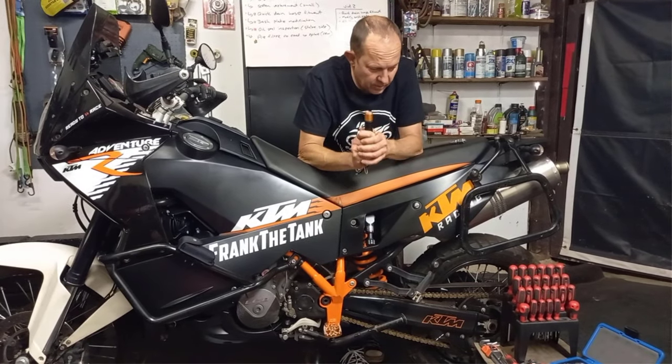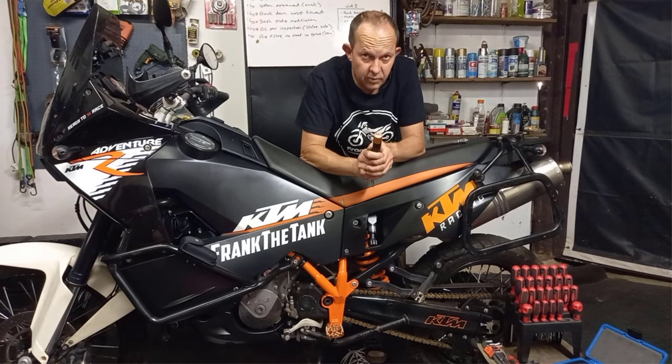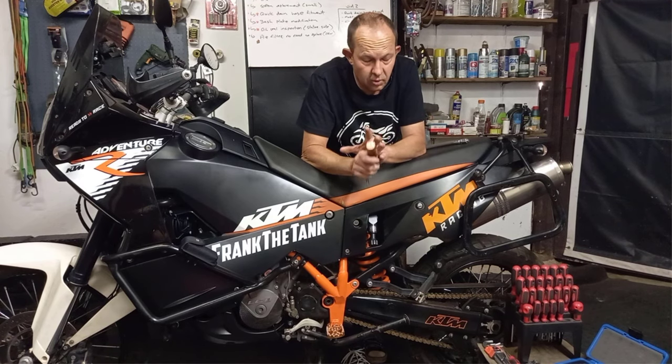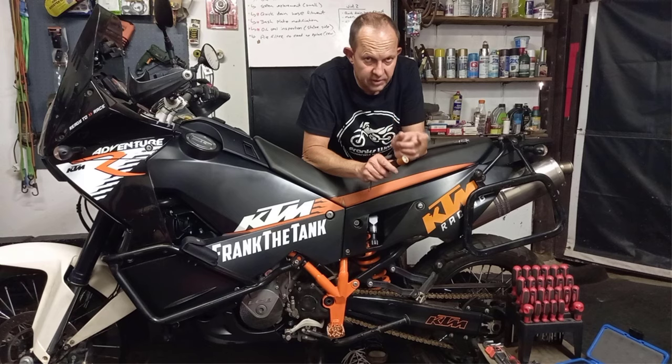On the plug side, I want to touch on the plugs. This is very important and you should take note of it. Your 990s, you have to have a look at the year model. I can't be 100% certain, but the earlier 990s had a shorter reach plug, and your later 990s, I think from 08 upwards, 09, 10, 11, 12, had a longer reach plug.